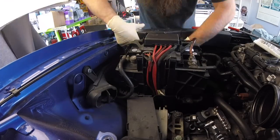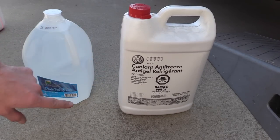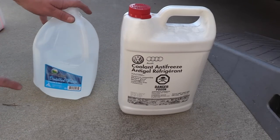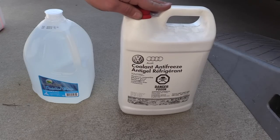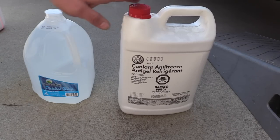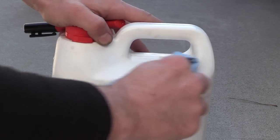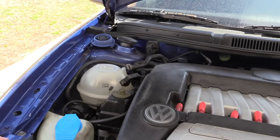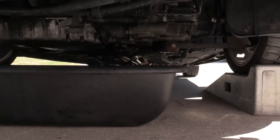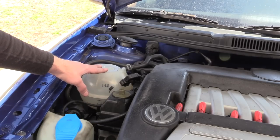We need to get the battery and the airbox and everything put back in and go ahead and fill and bleed the cooling system. We need to go ahead and mix our coolant — the OE coolant does come concentrated, so we need to mix it 50% coolant with 50% distilled, or what's even better, deionized water. You don't want to put straight water in, and you don't want to put straight coolant in. Make sure that you're using the correct coolant. Something I always recommend doing is marking it that it's mixed, so you never have to wonder if it's straight coolant or 50-50 mix. Before we put coolant in, I like to have the front of the car still up on the ramps or on the jack stands. That way we can have our drip tray underneath just in case it leaks, and it also helps put the coolant bowl at the highest point of the system, which will make bleeding the air out of the system quite a bit easier.